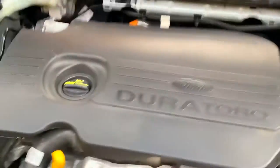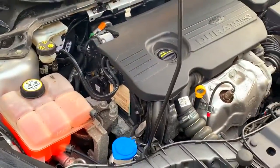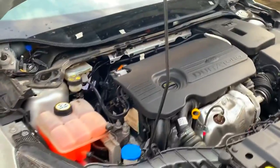And I found that there was a piece of tape stuck on mine, which is kind of about this point here. That's where the fan is. You want to get your airline on this and push it around with the air. I had a piece of tape on there, and eventually by blowing it all around, I managed to get this piece of tape out. Because getting that fan out from inside and taking all the dashboard apart is going to be a real pain of a job. So that's how I did it. And I'll quickly film how to put all this back together for you, so you kind of understand the process of taking it all off.